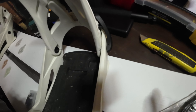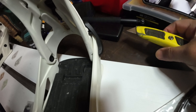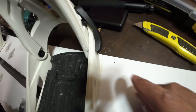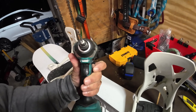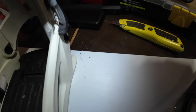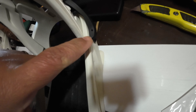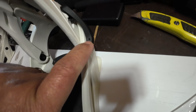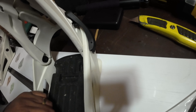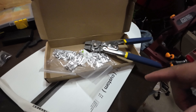I've marked with a blade where I want to start the hole and got a pilot hole started — you can see really closely how that's starting to look. I'm using what looks like a 1/16-inch drill bit. I went right in the middle of the lever — you want to leave enough material on both sides of the hole so it doesn't snap off.